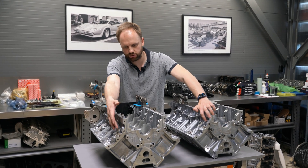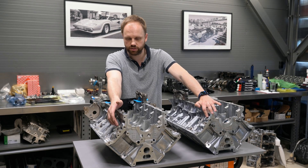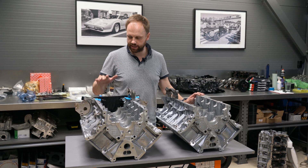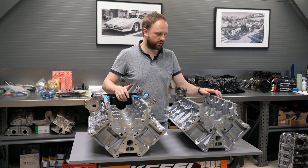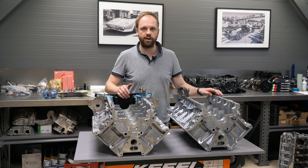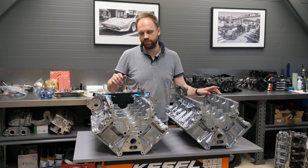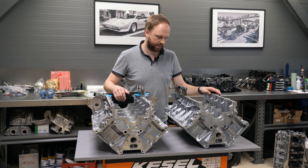These holes show that on the S series you have side holes that stretch the main cap to the sides, whereas on the N series you don't. The N series uses a single-stage oil pump, while on the S series you have a two-stage oil pump that draws from the front and sides — ensuring no oil pressure loss during high-G acceleration. On the N series you don't have that, though oil pressure is the same; it's mainly a performance reasoning.